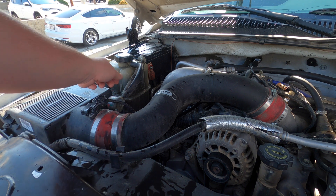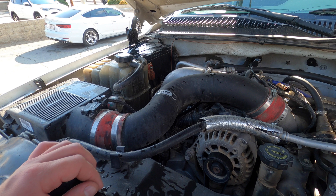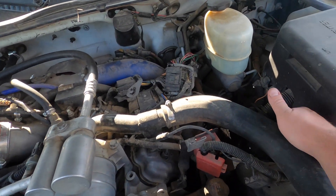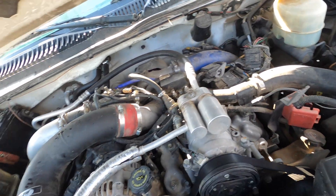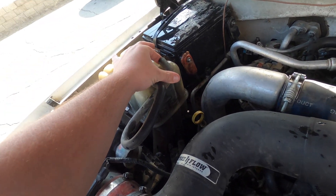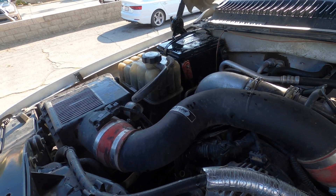The first step is we're going to have to pull the EGR cooler, make sure it's not ruptured. But more than likely we're going to have a head gasket issue. If you look over here, this hose — it's only run for about 30 seconds and it's hard as a rock. We have really high cooling system pressure. You can see the steam coming out. Don't let your truck eat Taco Bell.